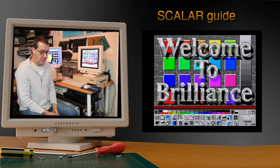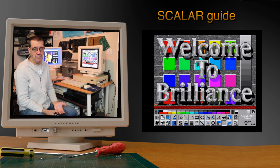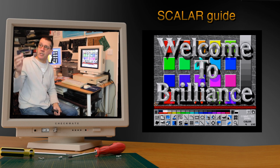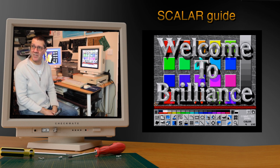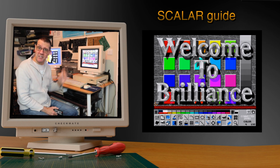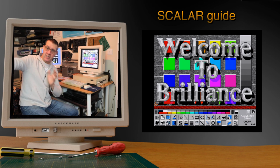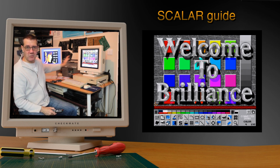Key takeaway from this is you must have a good quality cable. If you have got a rubbish cable with really bad shielding, you're going to get noise. You can see by this, if you're looking at this, that it actually looks pretty good. To be honest, it looks fantastic. Now I don't want to put animation on it, because if I show you the animation, it's output into the capture card at 60 Hertz, because that's just how I've got it all set up. You're going to see the animation jitter. On here, it's absolutely silky smooth.